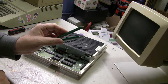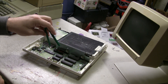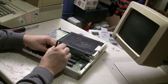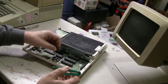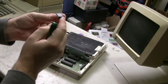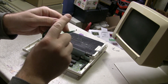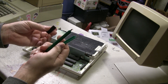Since I talked about it first, I'm going to go with the old standby and see exactly how difficult it is to extract the ROM chip on this Apple IIc. I'll go ahead and get everything lined up, see if I can get that slid underneath there — and it pulled up out of there. The chip came out just fine; this is the original Apple ROM. It didn't really bend up the pins or anything like that. But it was not very secure on the side, and you do need to be able to get these thicker blades underneath your chip, so if it's very snug down in the socket, you may potentially be out of luck.